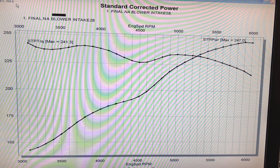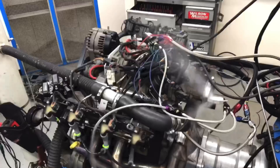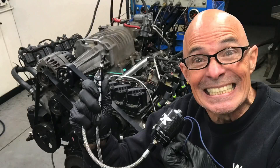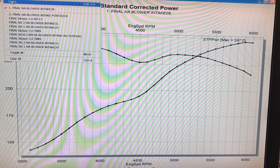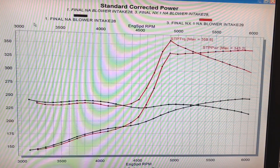This is the lower portion of the blower manifold. The reason for that is we ran this nitrous test before doing that upgrade. So this is our NA version: 247 horsepower, 241 foot-pounds of torque. Here's what happened when we added our nitrous from Nitrous Express — a simple wet fogger system with a 52/28 jet split: 52 nitrous, 28 fuel. The large disparity in jet size was because we were running high-pressure EFI fuel and E85. We plumbed the fuel portion of the nitrous with E85 as well.